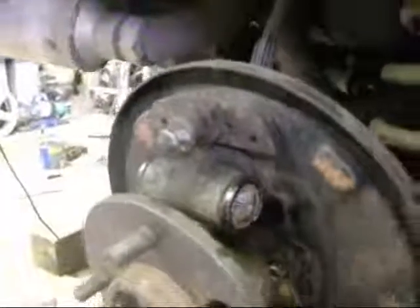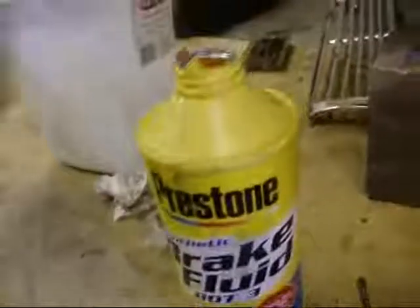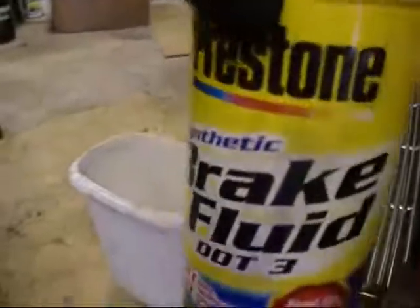All right. Well, I gotta put a battery in. Battery's getting weak. I cleaned it out, lubed it with brake fluid, cleaned it with a tissue, and lubed it up with more brake fluid. I'm using synthetic brake fluid, which presumably doesn't absorb water. It's not hygroscopic. It's not silicone brake fluid. Anyways, I put some inside, put some on the rubber seals. I'll put the spring back in that I cleaned off with brake cleaner, get all the goopy off of it, and I don't know why they seized up.